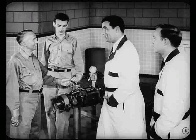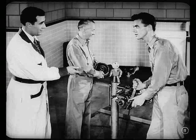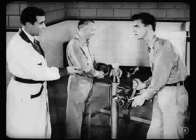Sounds good, Larry. Red and I took out both the transmission and overdrive as a unit, just like you said. You did fine, boys. Exactly what I wanted. Now, Red, suppose you and Shorty get the parking brake off and remove the governor and the rail lockout switch so we can start the disassembly. Don't lose that little plunger that falls out when you remove the switch.